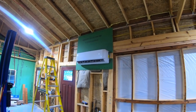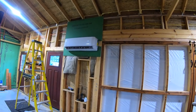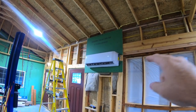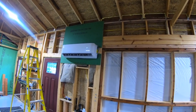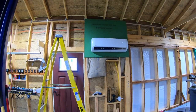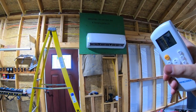Overall, it's about $1,200 with a bracket and that cover for the pipes and all that stuff - $1,100 off Amazon for this exact unit, and I'll put a link in the description. It stopped dripping since I adjusted the hose. I think what we'll do is actually replace that plastic drain hose with something a little more stiff so we never have a problem with draining.